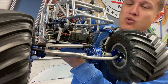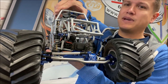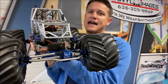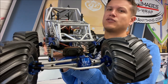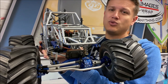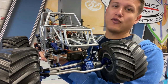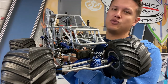Here's an example of the opposite - just a servo horn. This is an aluminum horn, and what that does is eliminate all the slop. Wherever that servo wants to turn, that arm is going to follow precisely. This is a very reactive setup - the aluminum servo horn eliminates any slop and creates a very tight steering unit. The problem is in an event of a servo shock or a big collision, the servo is going to take the brunt of it.